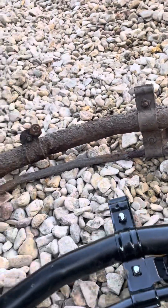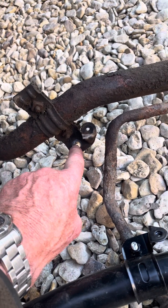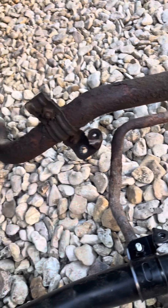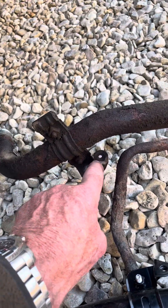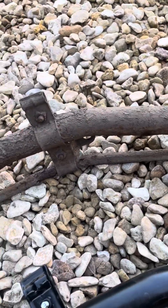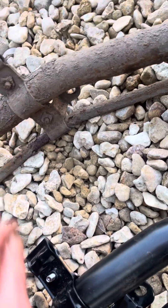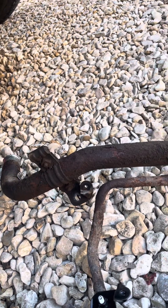So you've got that off and exposed it. Now, when you're actually taking this off — this is the new one beside it — don't move the brackets. There'll be a nut or a bolt holding those in, and that bolt is a 12. Leave the brackets on; just undo the nut where it attaches to the body. Because you'll need the spacings of the brackets — you'll need to mirror the spacings on your new part.